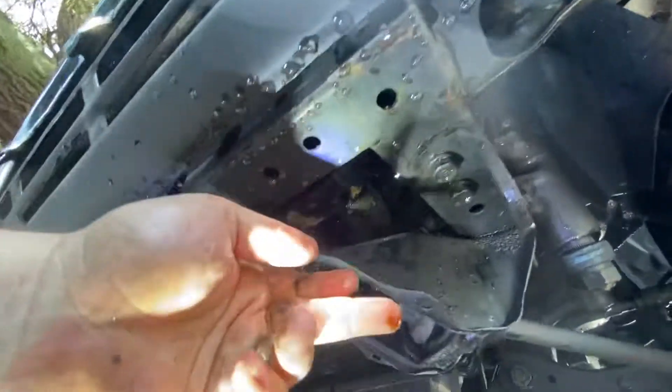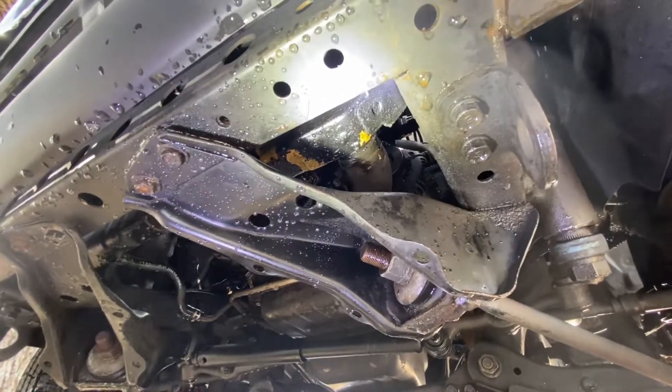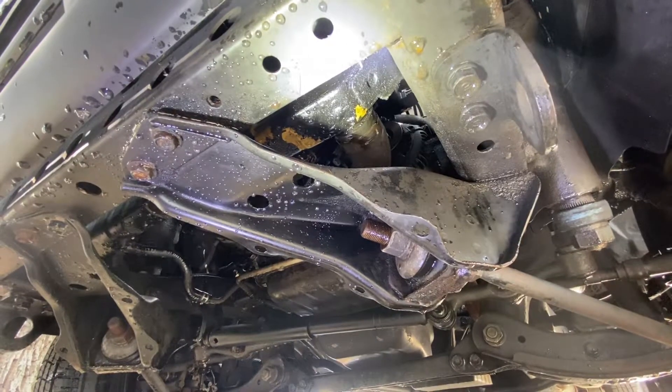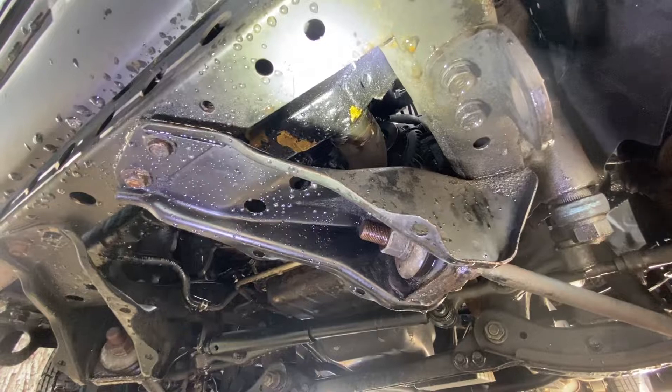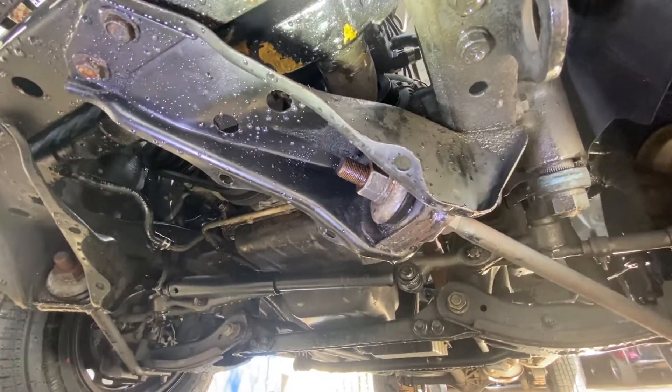If I touch it — see how it's dark on my finger and it doesn't look like water? That's the oil. The oil runs through the radiator on these engines and it cools the oil cooler, so that little hose right there at the point of contact at the radiator is also leaking. So that's an easy fix, that's a quick hose.